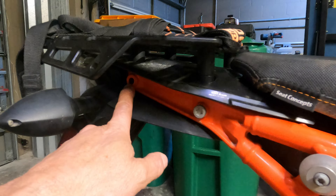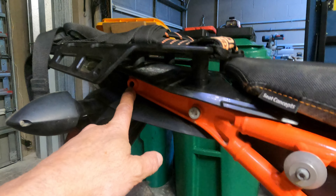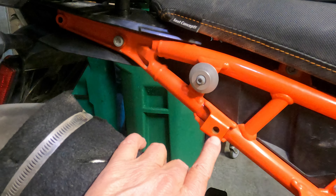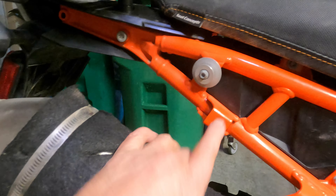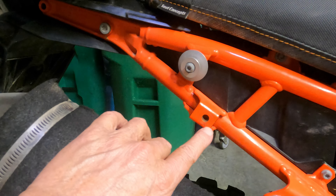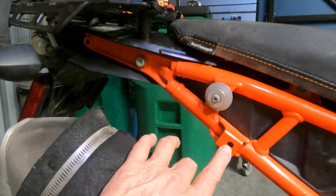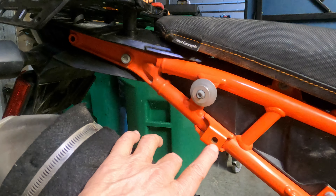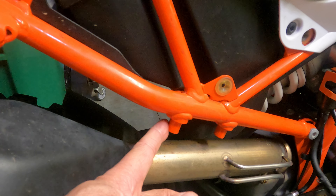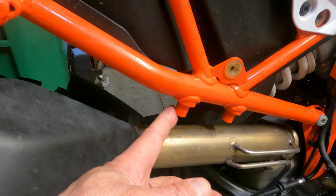To start, you have to remove the farthest back screw here. I went on a trek to find stainless steel hardware but was unable to find metric bolts. There's a threaded spacer that goes inside here that's also metric, but I already had a threaded nut that fits snugly, so I got a stainless steel bolt that will work for that. Down here I couldn't find spacers to substitute for the passenger foot pegs, so I'm just using a set of stacked washers to create the spacer I need.